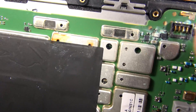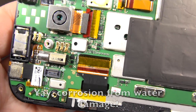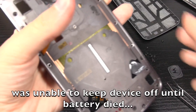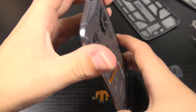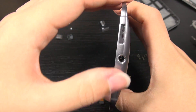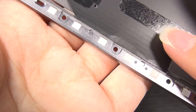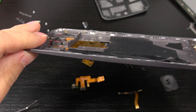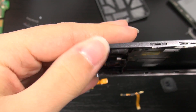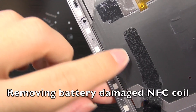On several different areas we can see quite a bit of issues. This device was just fried when I put it in the water. Now I find this mid-frame interesting — most of it is plastic and then you've got a little bit of metal; only the frame is metal. We can see where the metal meets the plastic. This outer metal band functions as the phone's antenna — there are little cutouts to prevent signal issues. This part underneath looks like the NFC coil, and you can see it's fracturing.